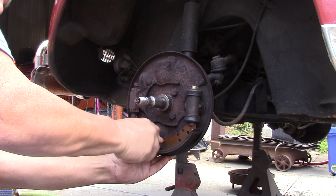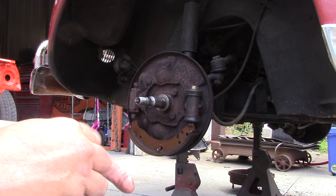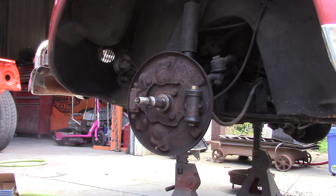For the shoe spring you need one of these tools, or you can use a pair of pliers. It just has a slot in it and then you turn it and the pin locks on — it's pretty basic. Put your finger on the pin in the back so the pin doesn't turn. Set those shoes off to the side.